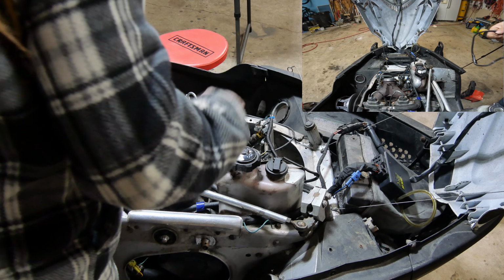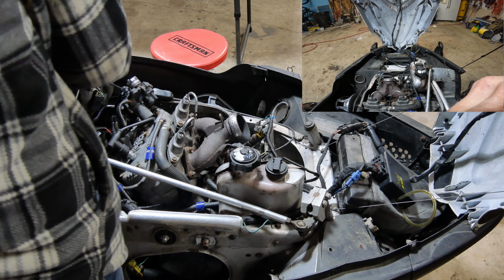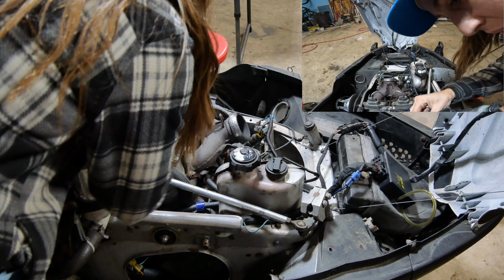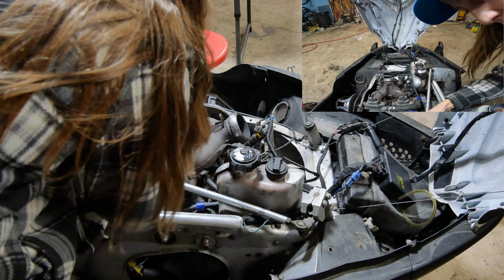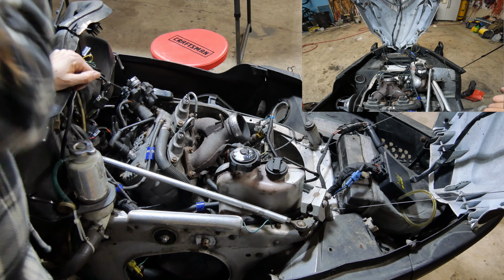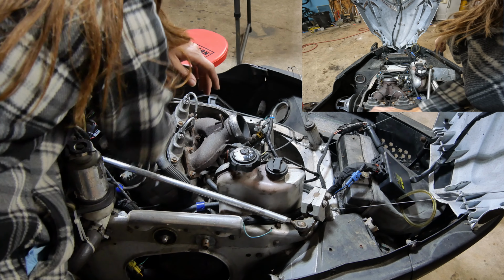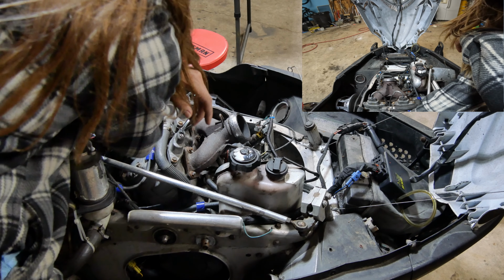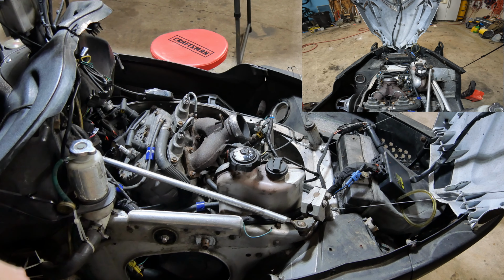Let's unplug everything again from the handlebars, without anything interrupting what's going on here. Okay, we're completely disconnected. The tail light's disconnected because people were talking about that. So that's all disconnected. We have brand new ground. So technically, we should have good spark. We do have spark sometimes. Well, let's test it again. Let's see if we are getting spark this time.